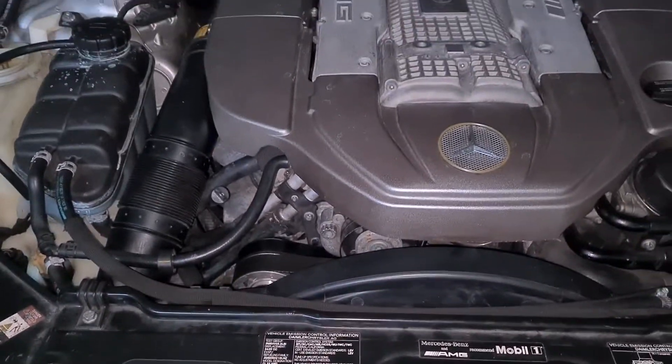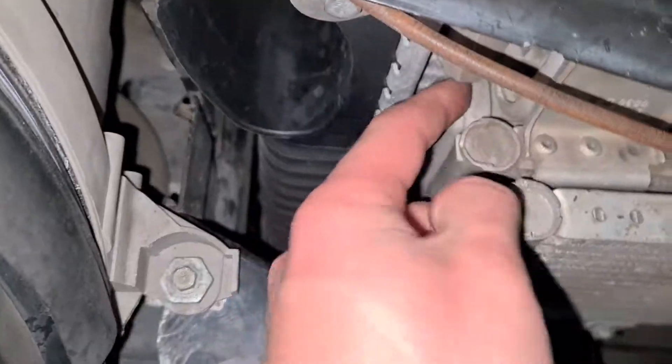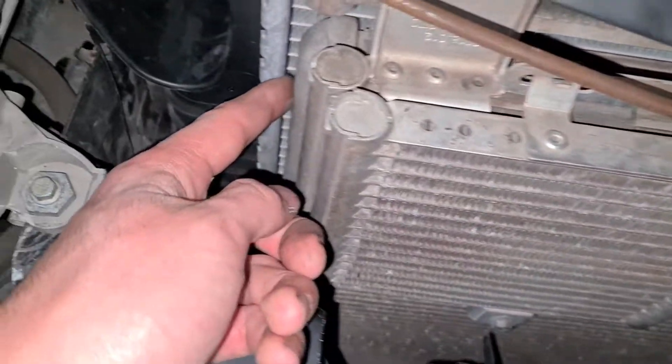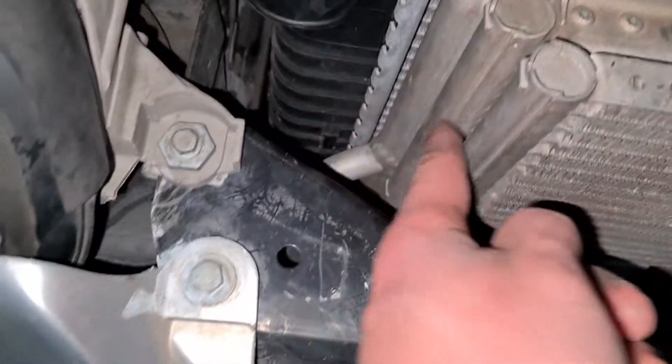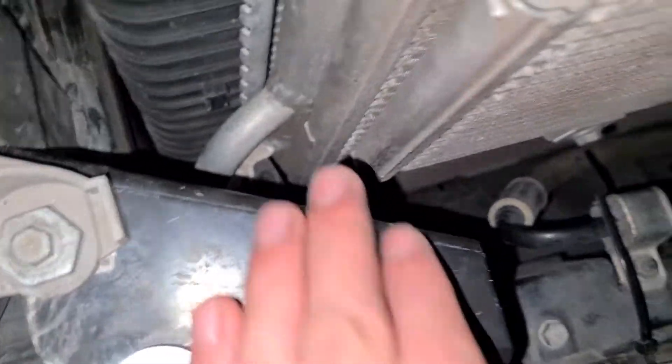On the CL 55, this line right here goes to that big one behind the one that says AMG, and it goes all the way down there. You can see the size of it — it goes all the way down there. That's the heat exchanger for the CL 55. That one comes here, and that one there goes to the intercooler pump. This is the heat exchanger on the CL 55 — it gets cooled off with the fan as well when you're in the staging lanes. It's a pretty beefy heat exchanger.